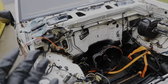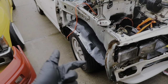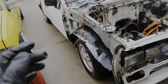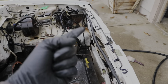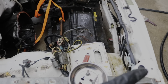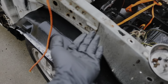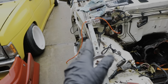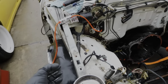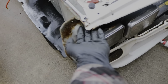This truck is going to be bagged and laying frame, so I have to be careful not to run anything very close to the tires since there's a high possibility it could rub on the harness. The plan is to take the harness off — you can see it runs right here along the radiator support — drill a hole somewhere over here on the side, bring it out through here, tuck it up nice, and clamp it to the outside since the fender goes all the way out.